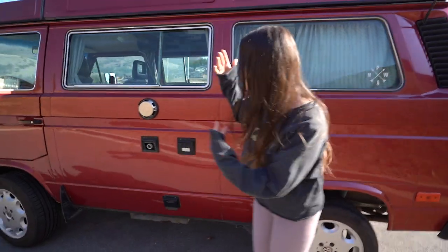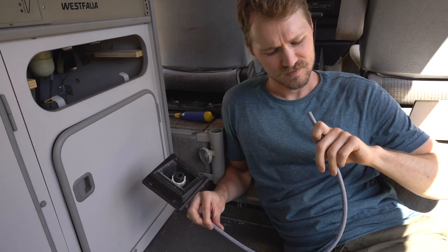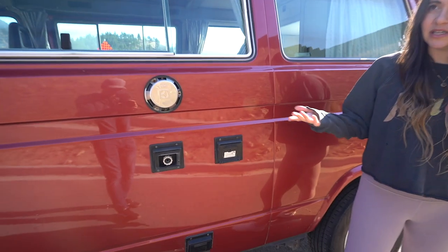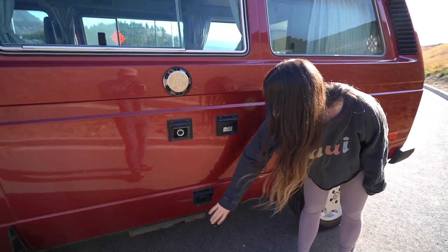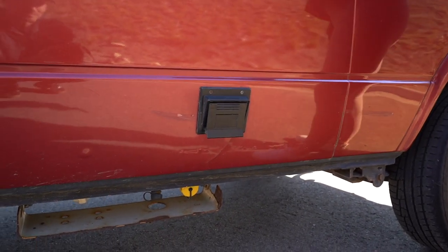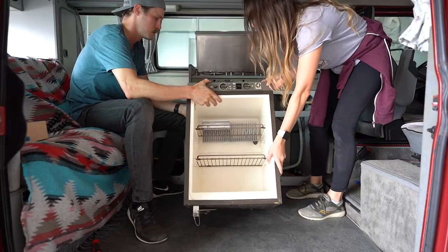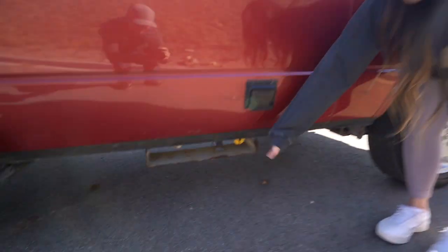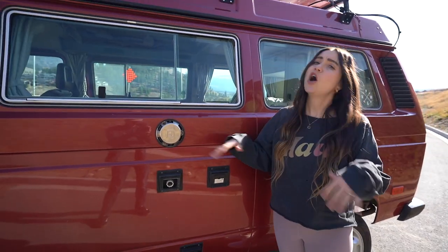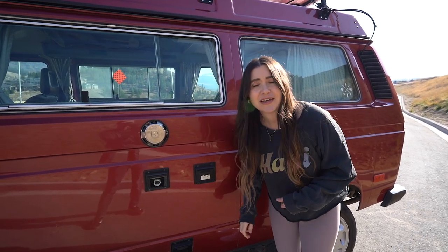Moving on, we have our hookup boxes, which we still need to replace. This is our city water, which was actually cut, so we did replace that. And this is our tank fill, which goes into the tank of the Westy. That is for shore power — we have an electrical plug there so you can just hook the Westy up. And that would be our flue vent if we still had a propane fridge, but we removed that. Down here is our propane tank, which actually lasts a surprisingly long period of time. We went about two weeks on a full tank using the stoves every day for boiling water, dishes, and cooking.